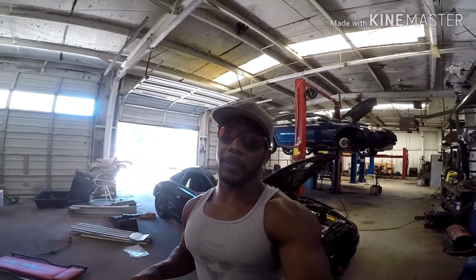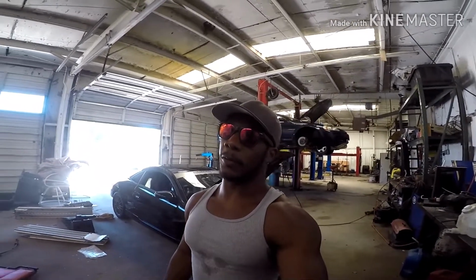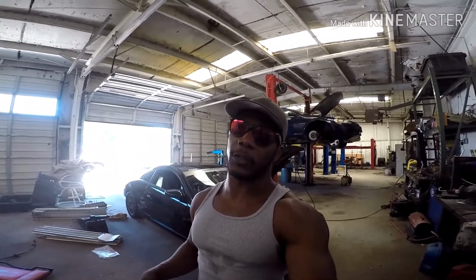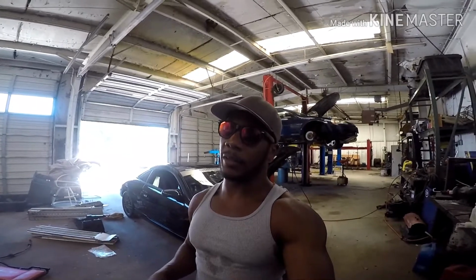That is from an eBay company that basically doesn't fit, the diameter is off, so you're basically choking your engine. For stock 3.0 headers, you want to get the Fed spec stock manifolds. Those are actually the best free-flowing exhaust manifolds.